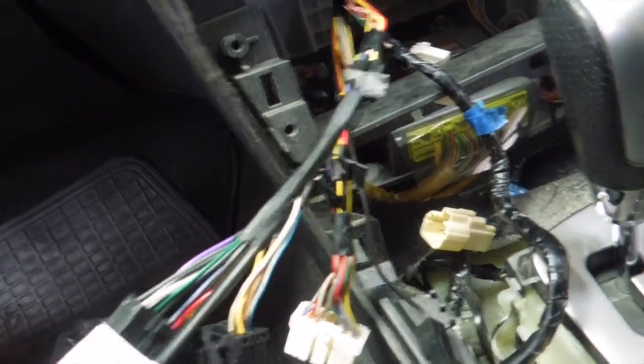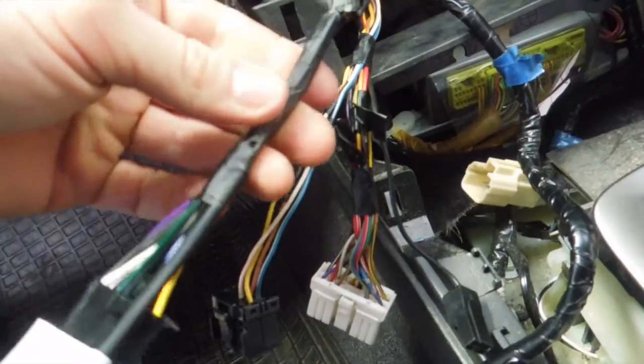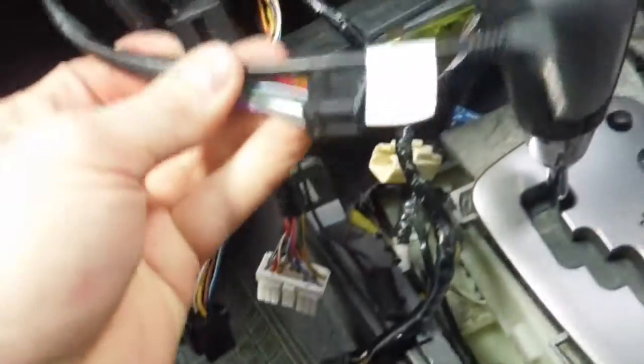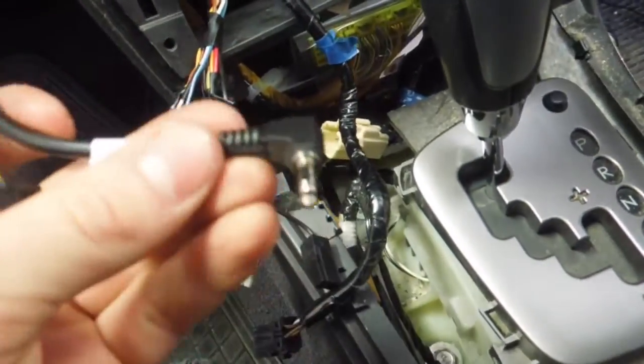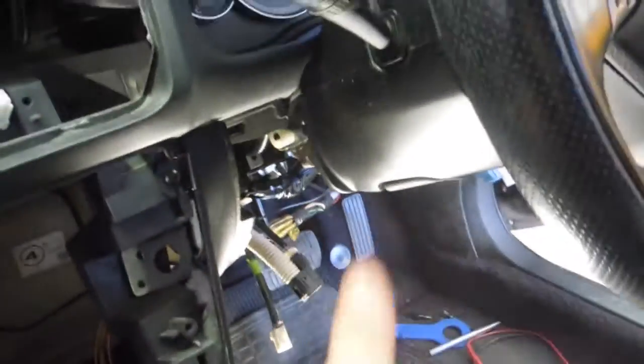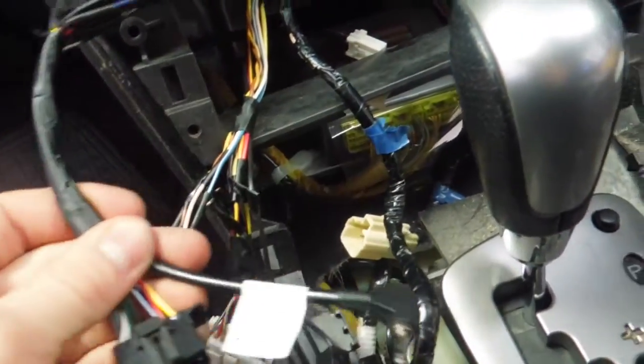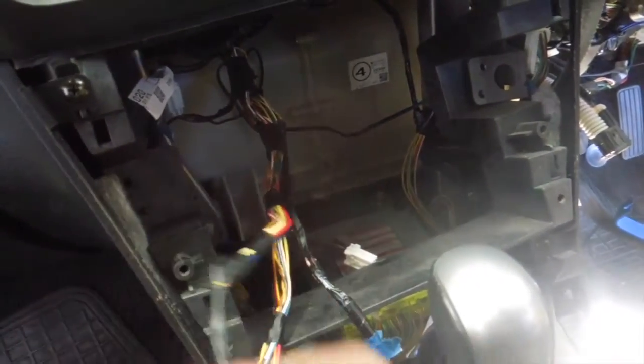Now obviously this jack here has 3 wires coming out. The ones you want to connect to are first of all the ground. I've taped over it, so now I've forgotten what I've taped to. So I connected the ground wire on this steering wheel plug, which is like the first pin that you see on there at the bottom. That one I've wired to the black wire, which is going off to the orange white wire under there. So ground on this thing goes to the orange white wire, and then the first input wire of this adapter that you get went to the purple wire over there,